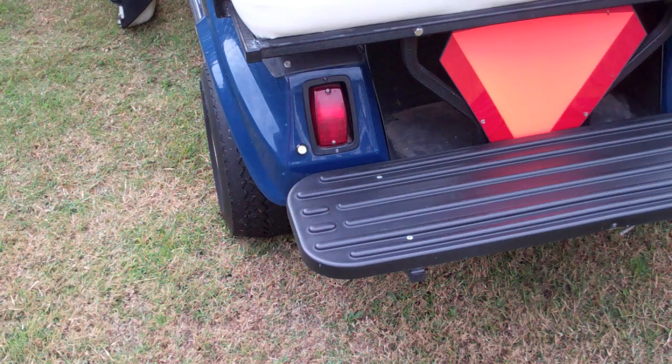This particular golf cart has a street legal package, so you want to test the brake lights and make sure they come on when you hit the brakes. If they're not working, it could be a sensor adjustment issue or a bad bulb. In my case, the brake lights only came on if you nearly slammed the brakes to the floor. I was able to adjust the sensitivity on the pedal sensor so the brake lights come on with just a light tap, which is how it should work.